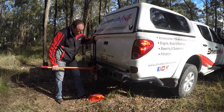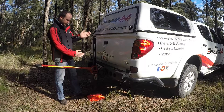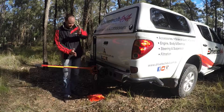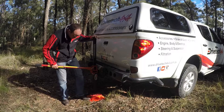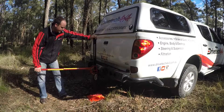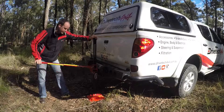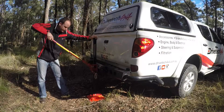With a little bit of tension on the bar, what we want to do is make sure that everything's level — not out of whack either way. Nice and straight, everything looks pretty safe. Also want to make sure that the base is nice and flat. Once we're happy, we can stand back and slowly start to jack the vehicle up, making sure that the pins move in and out nice and evenly.